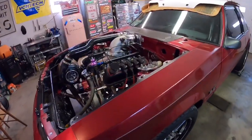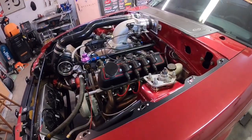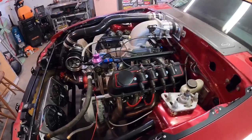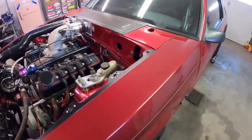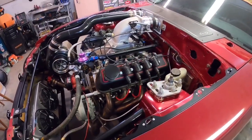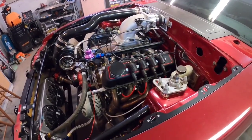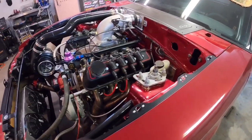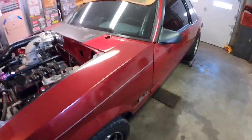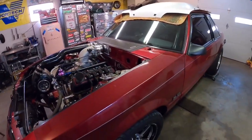If you're watching this video, you've probably already decided on a turbo 400. It's really a preference on whether you want to run a turbo 400 three-speed or a Turbo-Glide two-speed, or a Powerglide — you really can't go wrong with any of them. It comes down to your preference and how you plan to set it up, eighth mile or quarter mile. I like a three-speed since this car is kind of heavy.